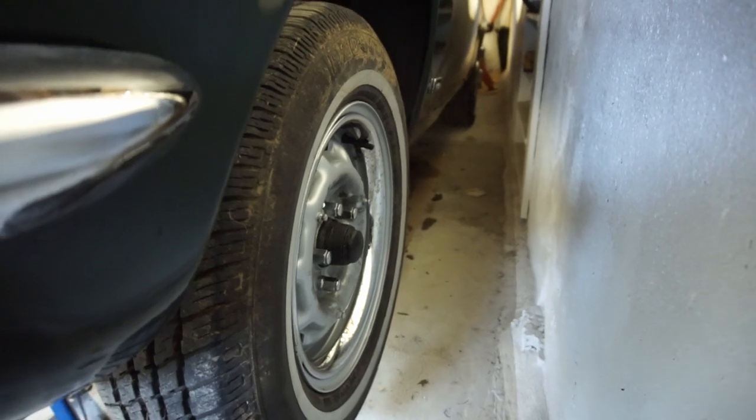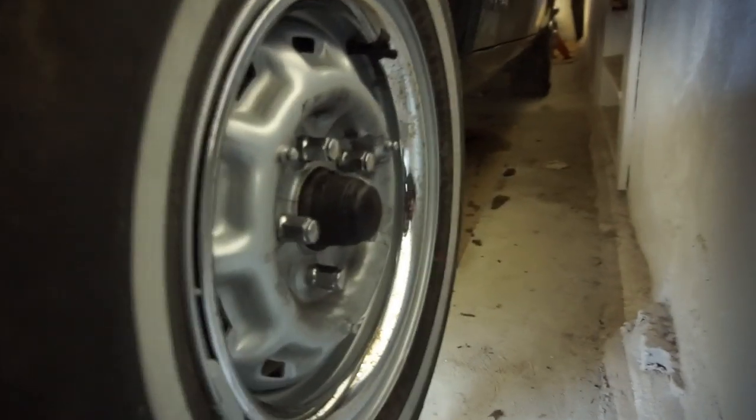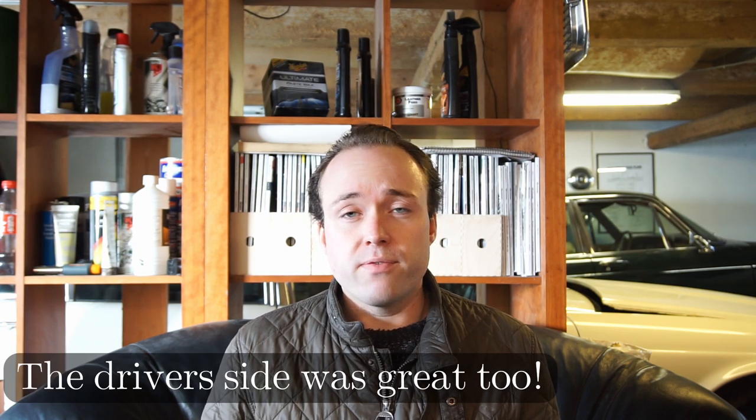So now I'm going to check this side, but as you can see it's pretty tight against the wall so I can't really get that on camera. But I'll let you know if everything looks as good on this side — it might even be better because I actually see five lug nuts on this side, so we're already off to a better start. So overall I'm really pleasantly surprised with what I found. Nothing severely needs to be replaced at the moment. Of course I might feel other things when I go out for a drive, or hear something knocking or feel something loose, or the inspection/MOT place might find something. The only thing I really saw that I'll want to replace is some of those bushings for the anti-roll bar, because they were quite compressed and starting to crack. But they cost almost nothing and they're really easy and quick to replace, so I'll do that a little bit further down the road. There will be a future video on replacing all that brake fluid, going through the brakes and bleeding everything, so that's coming up pretty soon.